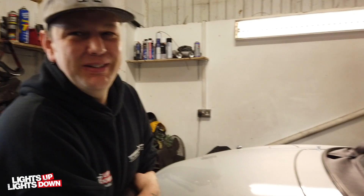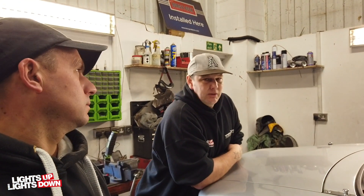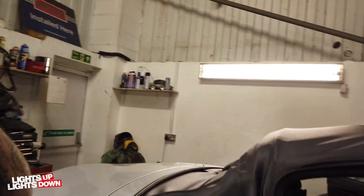For everyone that owns an MX-5, especially Mk1s - the floor rails at the bottom get crushed, either from being jacked up on. We've just literally designed a new floor rail panel front to rear, where you remove the existing box section and put the new one on. They're prototype ones at the moment, but Roy is mounting them on his car - he's got one side at the moment. They're also thicker so they will stiffen the car up a bit as well.